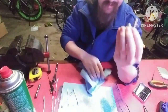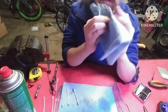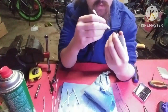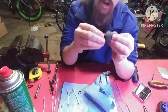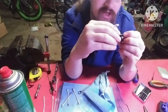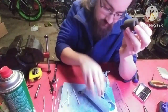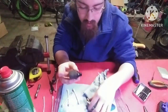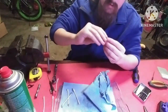All right. Then you can also just try and clean up the outside a little bit, wipe it down. You get it all nice and looking good, and then your carburetor's cleaned. And you can also clean this boot. A lot of times you end up with your air filter oil on the boot. Now, this is not the best air filter in the world. In fact, this is one of those knockoff K&N filter things that don't really do much of anything. That's why I got this pre-filter on the outside. I probably won't even run this filter. Not a good filter. Does look cool. Not great. Put the zip tie back on there. Then carburetor. Boom. Done.